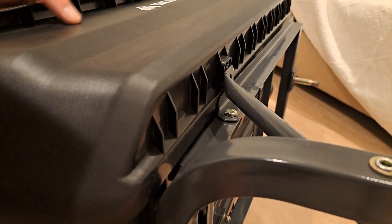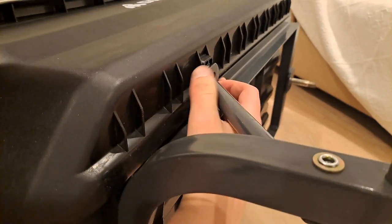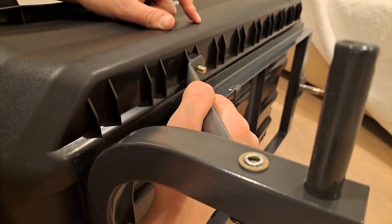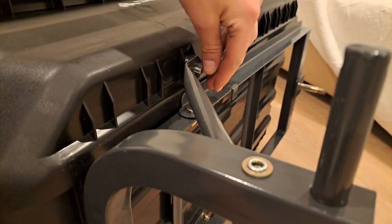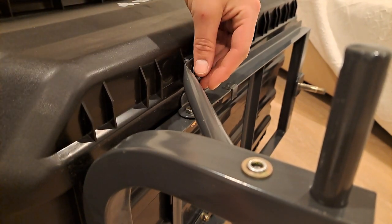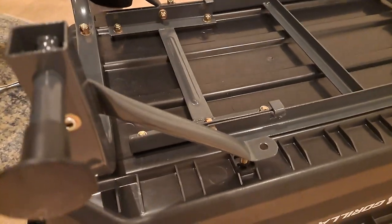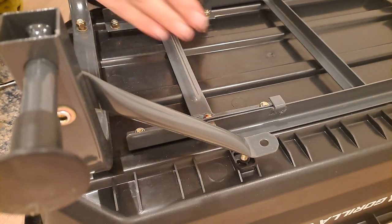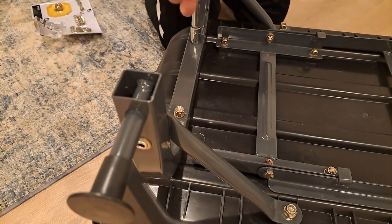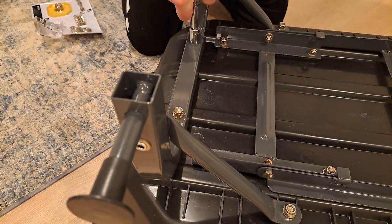You want to get the next two smaller bolts located first. To install these smaller bolts you're going to have to move the support bracket. It's actually easier to put the bolt through first, then push the bracket up and use the bolt to hold the bracket in place. Then put your washer and nut on so it doesn't fall out. It can be quite easy to knock that bolt back through, so be careful. Switch over to the other side — once the bolt is pushed through you can move the axle and get the support bracket secured. Get everything fitted first, then tighten it all up by hand.